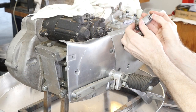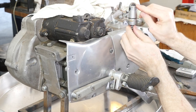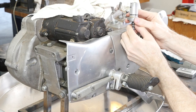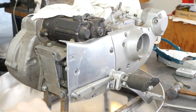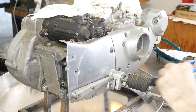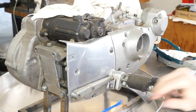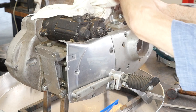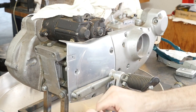Push the lifter in. Maybe this camera's better to show it. Put the lifter back in. There we go. Try not to handle it too much. There's rollers inside here, and they say you're not supposed to put rollers in solvent. So what I like to do is give these no chance to get any dirtier than they are already. We'll put that in here. I guess we can be a little Mickey Mouse, put the bolts in. So we lucked out. Oh, good, they're all coming out easy. You saw what happens if you can't get them out easy.